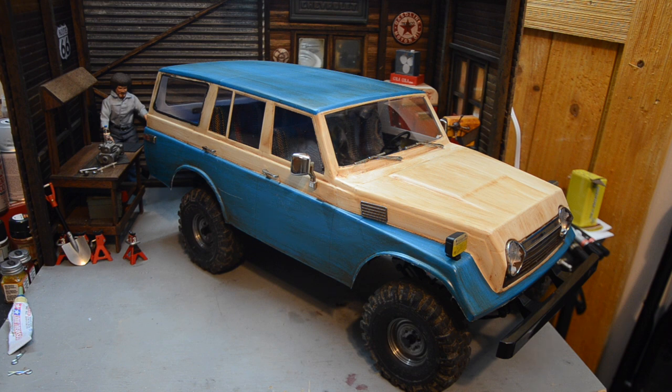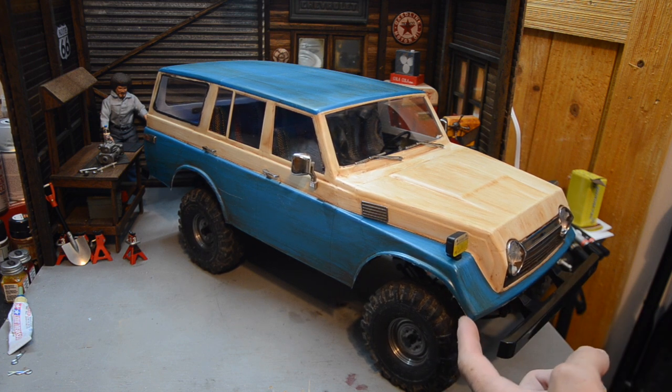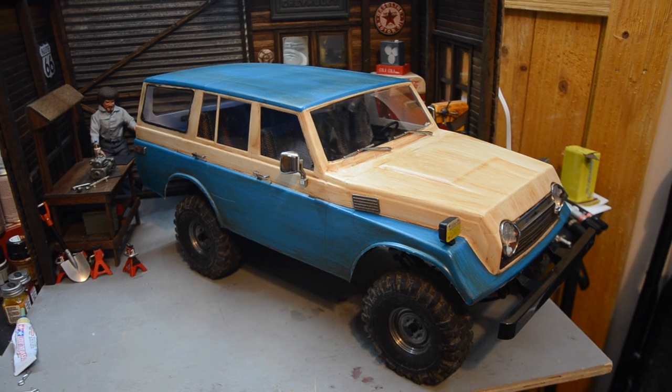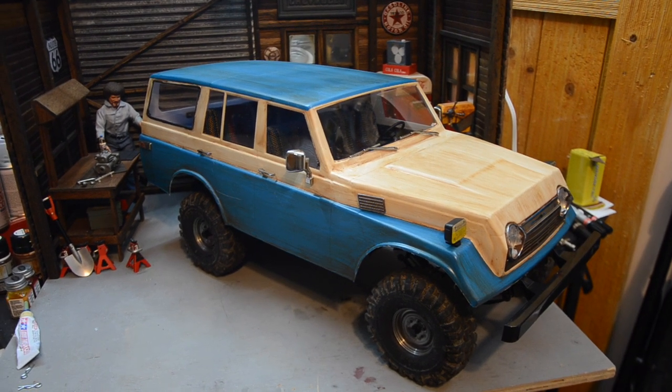The headlights, you're supposed to drill 3 small holes and then cut out the middle. Well, the Lexan is so hard up here in the nose that, I mean, you saw me earlier in the video, I couldn't even cut this front lip with full-size scissors, because the Lexan is so thick right there, because there's so many curves in that piece. Very solid. So that was very challenging. You know me, I'm not a Lexan fan. I'm not an expert at doing Lexan bodies. And I know I'm doing this the obscure way, painting it on the outside and weathering it. But, man, that was difficult.